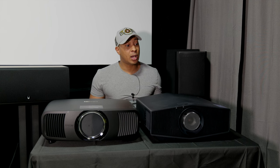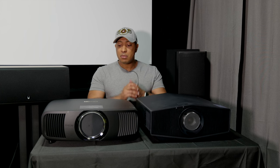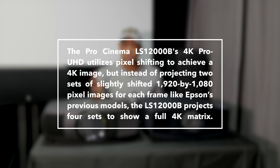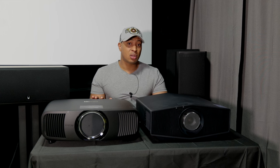I'm not sure what 'infinite contrast' means exactly — that's just what it says on the website, so you may want to reach out to Sony. The Epson will get very, very bright at 2700 lumens versus 2000 on the Sony — the Sony gets beat there in raw lumens, though it should still look really good. For resolution, the Epson is 4K E-shift — which has been improved over previous versions, shifting or stretching pixels to achieve 4K. The Sony is native 4K, so no E-shifting — straight out of the box. The Sony will likely have a better picture than the Epson, though the Epson still looks very, very good.